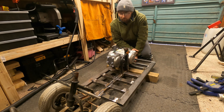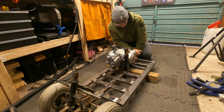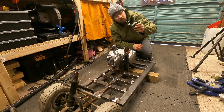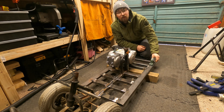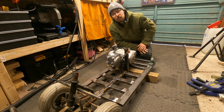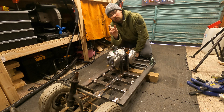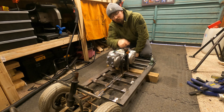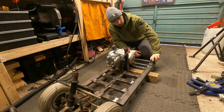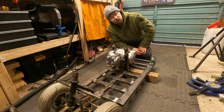That's all the welding done. I've got all the frame tacked out and managed to get the engine bolted in - that is awesome. Next I need to get the axle set up. To do that I'm using these pillow-type bearings and literally going to drill and bolt them into position, with the ability to slide them back to adjust the chain tension. This should be a lot easier than on the drift trike, where I tensioned the chain by moving the engine on an elongated mount. With these M10 holes and pillow bearings I should be able to pull them back and adjust the tension nicely.